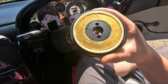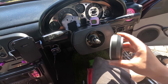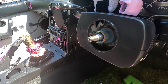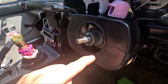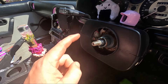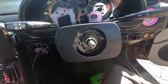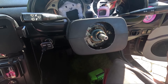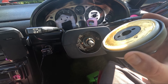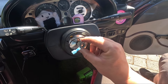All greased up and ready to go on. I just need to line up the two holes with the two plastic nubs — make sure you don't force it on because those plastic bits will break. I'm having a little bit of trouble — the raised ring on the steering column cowl is contacting the white ring on the boss kit and we can't remove that white ring. I've got spare cowls so I don't mind trimming this one. I'm simply going to cut this ring out — I had to go a little wider than expected and it's not the neatest job, but hopefully it should now clear.